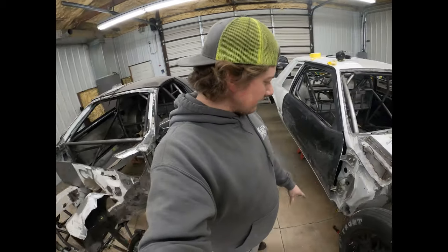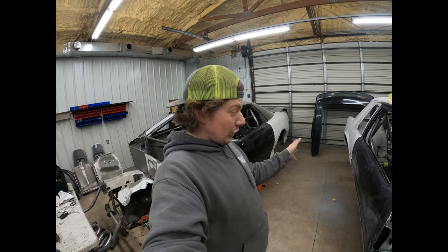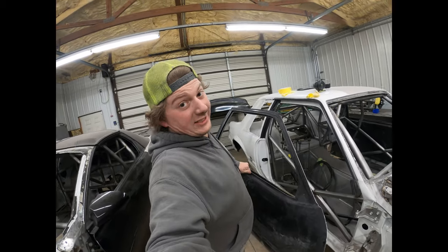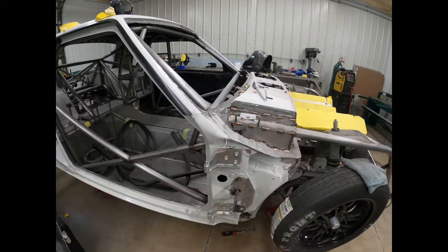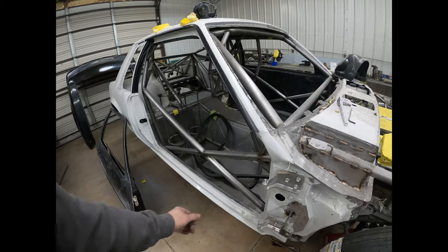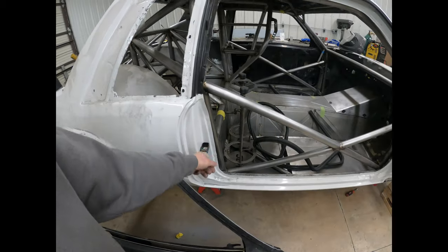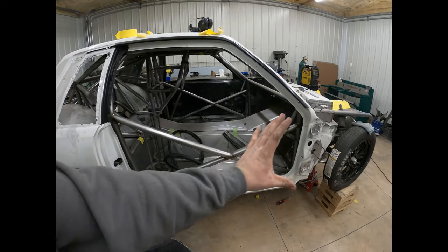Moving the hinges with the door off is a lot easier once it's fit enough that it can close mostly, at least on the first catch. So what's nice about these, you can take it off one-handed. Then just loosen the bolts and move it however much, whichever way the door needed to go. If the door needed to go up, then move the top hinge forward, or move the bottom hinge back, depending on where it needed to be on the striker. That's the biggest thing, adjusting the door to land on the striker where you need it. So that's forward and back with the hinges.